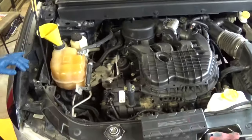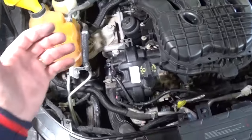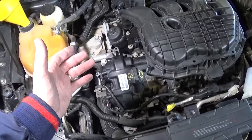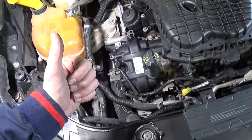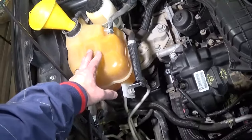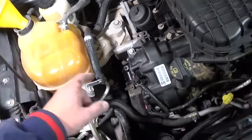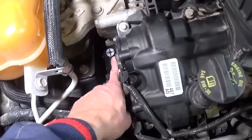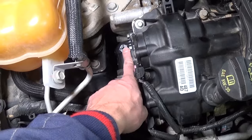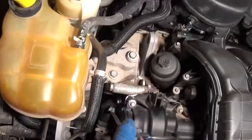In today's video we're going to show you how to bleed the cooling system on this engine, so stay with us. We have more than 200 videos covering the whole engine — torque specs and everything — so please subscribe to the channel if you need help. Right here is your coolant overflow bottle. We need to remove the cap from the coolant reservoir. This here is the bleeder valve on the thermostat housing, so we need to take this one loose and then start adding coolant.